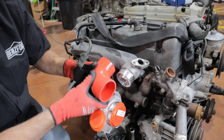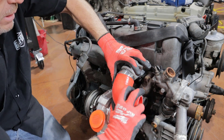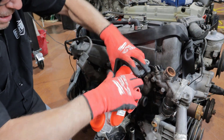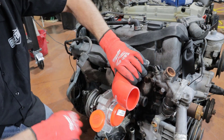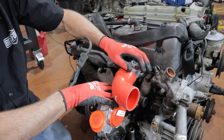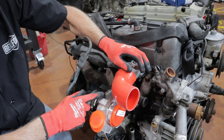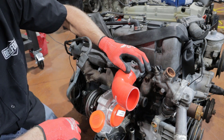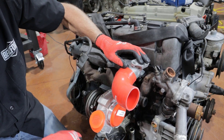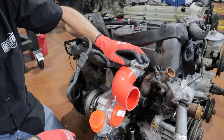This is just the Mishimoto elbow — it's a tight radius turn — and if I hold it up here you can actually see there's room to trim a little bit if needed. I did push it all the way back to the manifold, and as you can see in the product listing on the website, there is enough clearance to almost put my fingers through here with the HE221, even at the wastegate mount which is a little thicker. You can angle this however you want and probably find different angle couplers if needed. That's the new OM617 intake adapter — if you have any questions, please let us know. Thanks for watching.